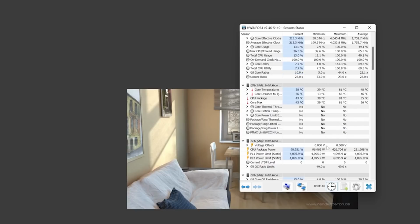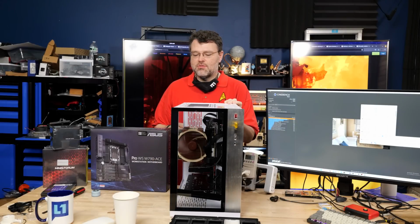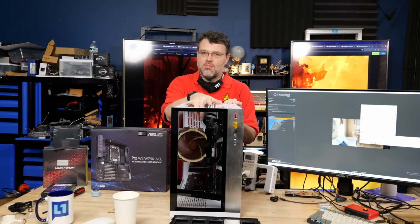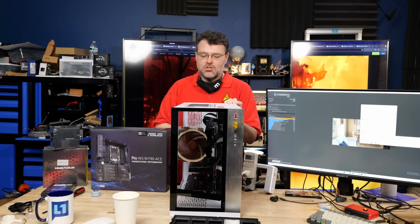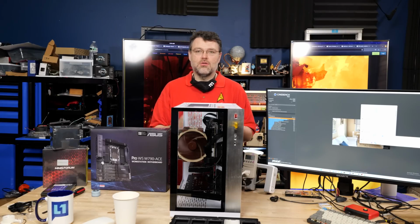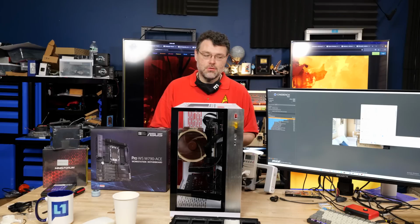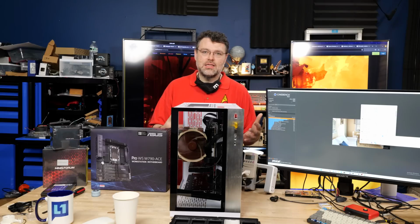Now, one thing that our Lian Li case is not fabulous about is that it doesn't have a super direct path for the rear I/O. The vent at the rear here is not large enough, in my opinion. So having a fan located at the top pointed out to pull air out of the top this way, so that you get kind of a chimney effect, I think really helps cooling when the thing is fully assembled. Of course, when I'm testing this, it's basically open air, so it's sort of a best case scenario for cooling with this cooler.